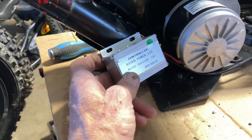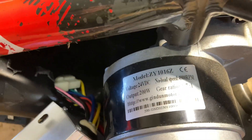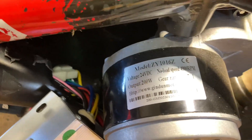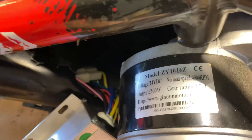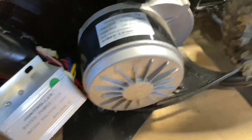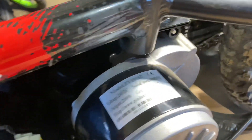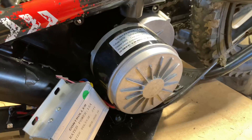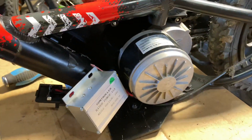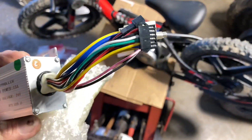I've got a replacement — verify it's the same one. 200 watt, gear ratio 9.7 to 1 for anybody that wants to know. 24 volt, maximum RPM is 4900 — she's a ripper. Notice my motor is all sealed, so you're not going to have to worry about dirt and all that stuff. Sealed gearbox, sealed — just a good little motor. These are the same ones that came on the Razor-type stuff, tried and true technology.